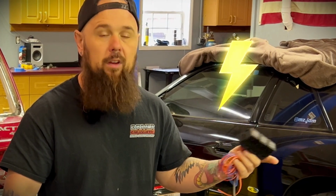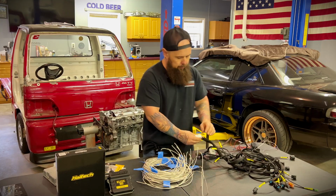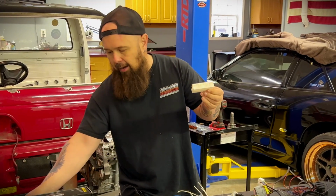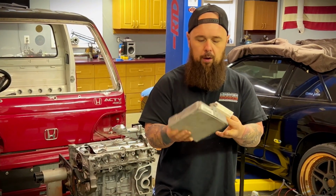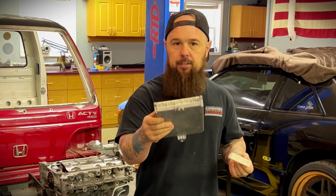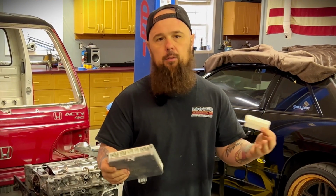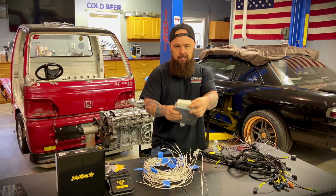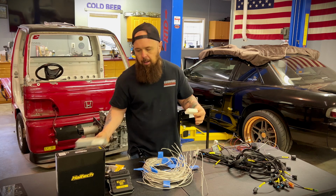I've got the Hybrid Racing universal K-Swap harness adapter. This will give power to the bare bones of what the K20/K24 needs to operate. That all comes together right here in this little guy. So I bought this online, and this represents where normally the wiring harness would plug right into the ECU, right? Plug it into the ECU, ECU tells everything what to do, gives it power and direction. Well, all I needed was this little portion right here. So forget about this now.